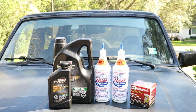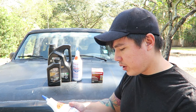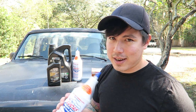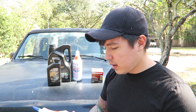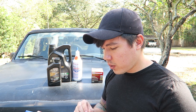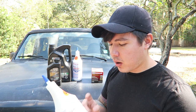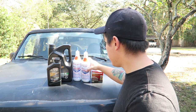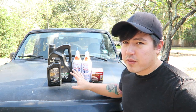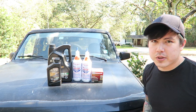There's a little bit of a misnomer — synthetics are thinner, but synthetics are designed to provide more protection than conventional motor oil, all around, even for older engines. I'm also going to be adding some heavy duty oil stabilizer. This is like thick goop, but it's strange because once it mixes in, the oil doesn't thicken more — it just provides a little bit of a coating and more protection for the bearings and wearing surfaces. In the cooler months here in Florida, when I hear these symptoms more, I think this is going to provide more protection during cold starts. And of course, our Motorcraft filters.